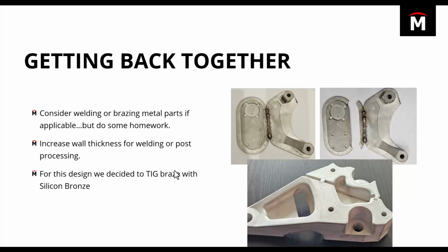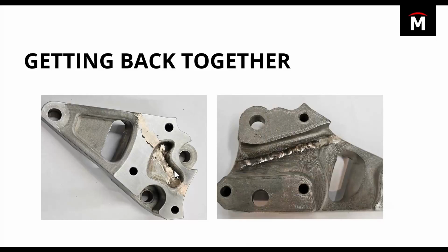And then I bolted the pump to the front face of these components. That helped me get all the holes aligned when I went to start brazing this part together. I also bolted each of the mounting holes that would bolt to the cylinder head of the engine down to a fixture table that I've got. That made the process of getting this thing all lined up pretty easy. So once it was lined up, I went ahead and started brazing this thing out. And here's what the finished results look like.